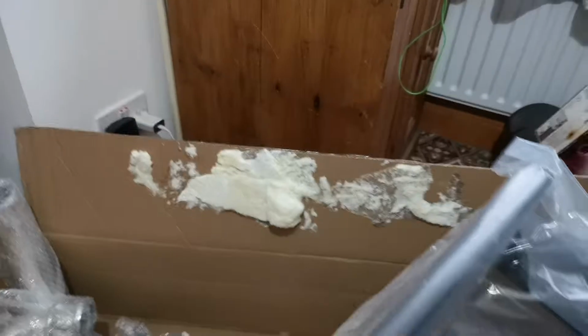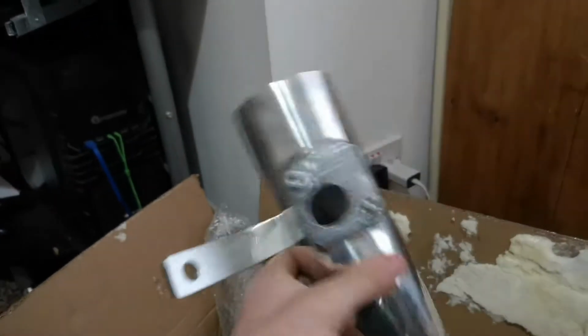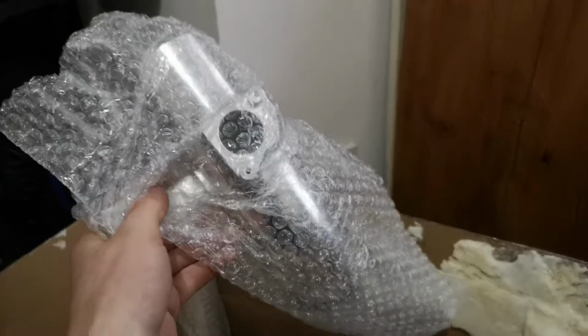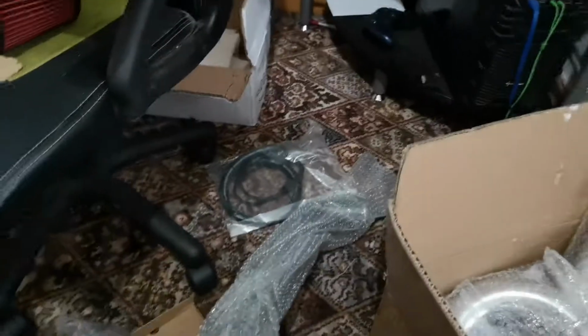It's good quality stuff. I've used Japspeed before. It also comes with, which is freaking heavy, a replacement crash bar, because obviously you have to take the original crash bar out, and then it's got these holes you can see in it. Those holes line up with these holes, and that holds your intercooler in place. They also send these, which is obviously the short ram induction. Your MAF sensor goes into there. They also send two of these, just an extra one, because this kit can also be used for a Legacy and the Hatch, because some of the Legacys are twin turboed. You have two. So, for the price, you can't go wrong.